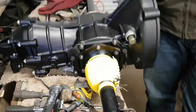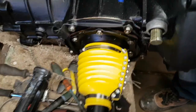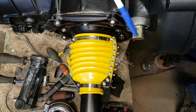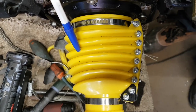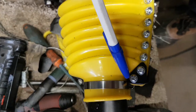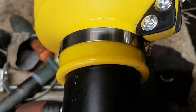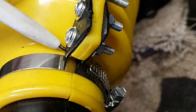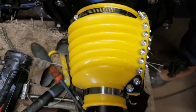Here we have the axle boots. This is the 1300 from July 1972, so everything is a little bit larger and slightly better. That's the 20mm fork rod. But these axle boots — these are from Empi, they're neoprene. And what I've done here — see here — I've made two plates. It goes around there to around there; there's one underneath and there's one there. And that is to press inside the corner a bit more so it actually seals it properly. I don't need to put any glue on these; I'll make sure it seals by itself and it's longevity. It's a good quality neoprene. I went for the yellow to have a bit of contrast with my black on that, and I can see what's happening. And I've already made the other side as well.